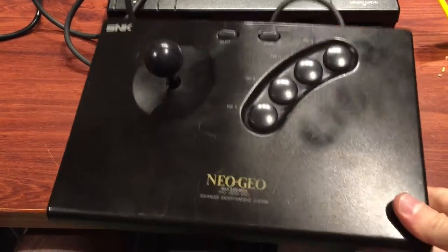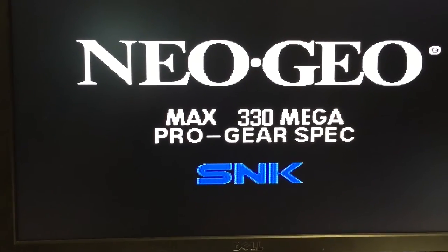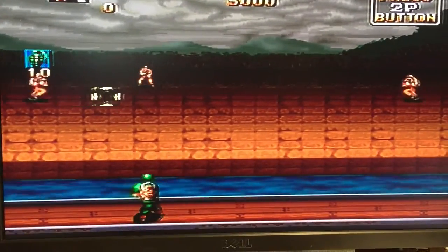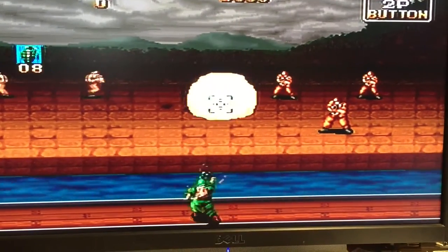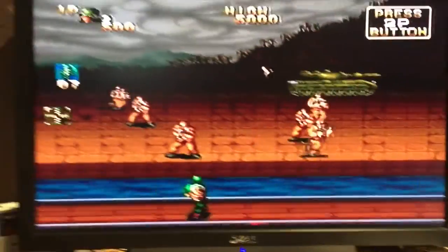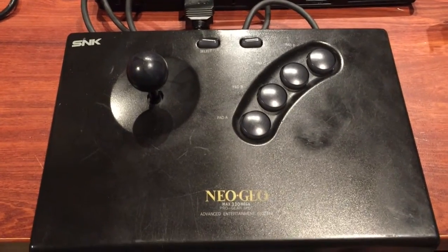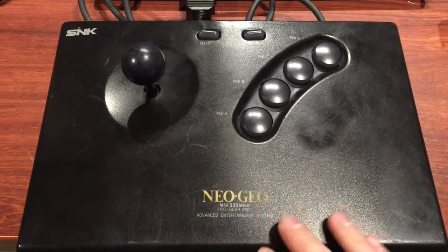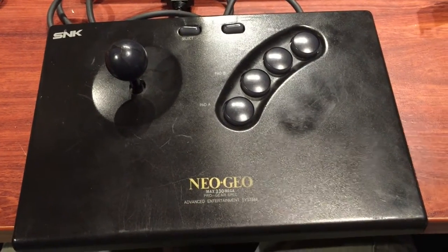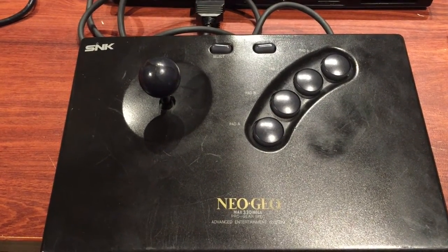The controller is all back together and looking good - let's give it a go. We've got left, right, up, down, we've got shoot, we've got grenade - B button's working now, dash - yep, everything's good! So that's it - buttons are all working, joystick is working. Just some fragile wires and desoldered wires. Pretty easy fix - just a matter of going through and measuring the continuity for each pin one by one. I hope that was helpful and as always I'll aim to post another video here soon. Thanks for watching!